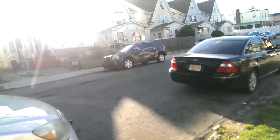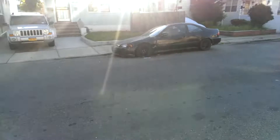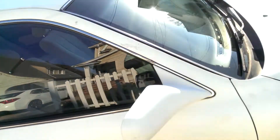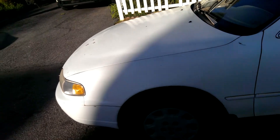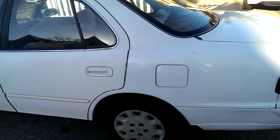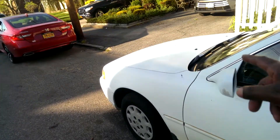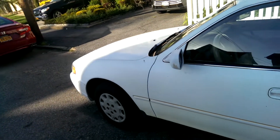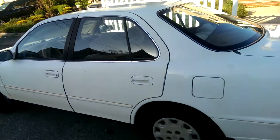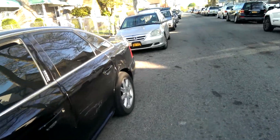The Camry is still here and it's not going anywhere. I actually started sanding down the rough spots because I'm thinking about teaching myself how to paint it. I still need to do the front left axle, get the oil leaks fixed, get the cam seals done, change the oil pan gasket, and do the timing belt and water pump. But the Camry is staying — I'm not selling it.